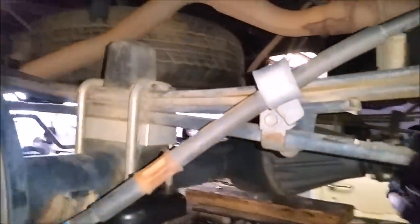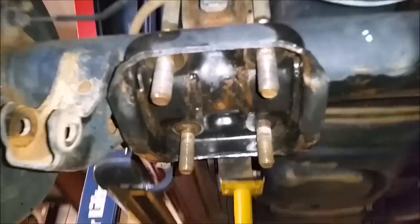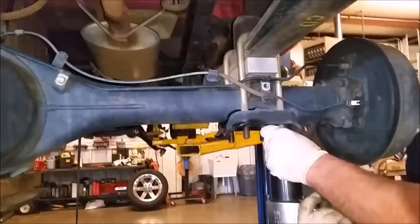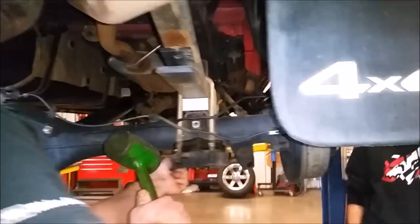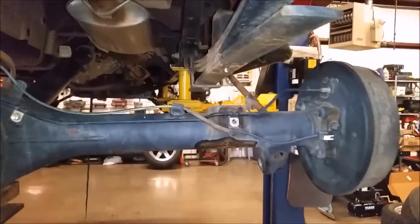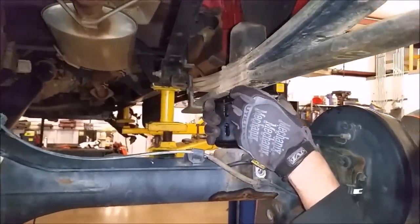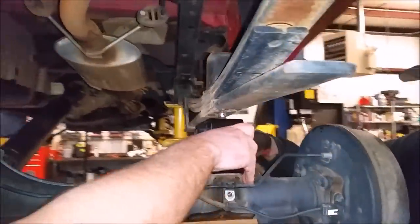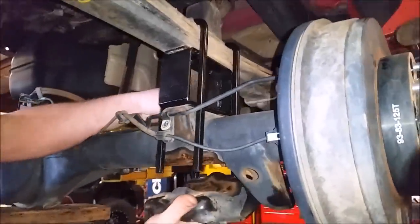So we're loosening up some of the brake lines — there's also one on each side of the leaf spring right here. We'll go ahead and take all those bolts out to give us a little more room. We're now working on taking the U-bolts off — just the four nuts right on the bottom here. Now with our original lift kit block out, we're going to go ahead and reinstall a new one. With that on, we can use the supplied U-bolts, put the original bracket back on the bottom side, and then tighten them up.